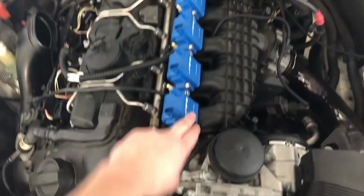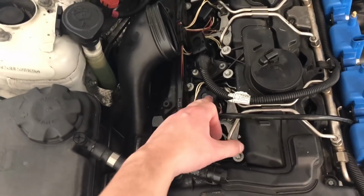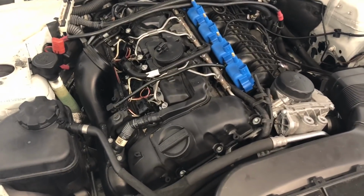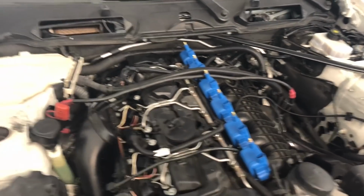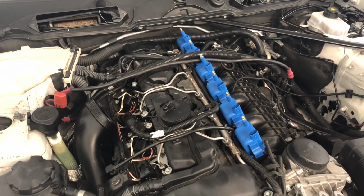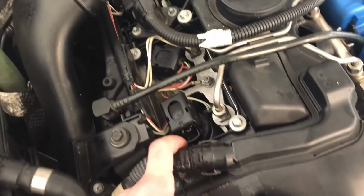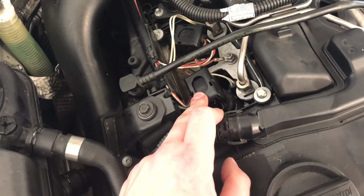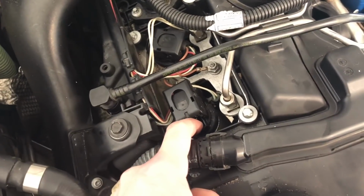Okay, guys, so these are in. Now, just to pull all of these coils out. You know, it's weird. These coils, they seriously only have about 1,000 miles on them, and they're new Delphi coils, but at higher RPMs, I get some sort of issue with the BSD communication line, and my car overvolts. So from what I've been reading on the internet, because that's obviously the best place to get car advice, these Delphi branded coils, although technically compatible and recommended by BMW, well, they're not recommended by BMW because they're not BMW parts, and that's the problem, have different insulation here at the top.